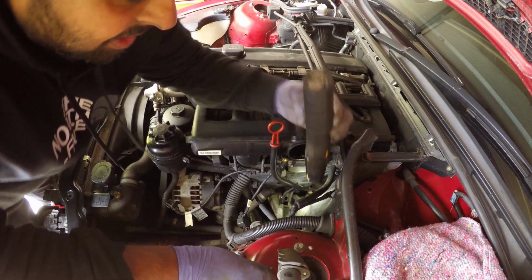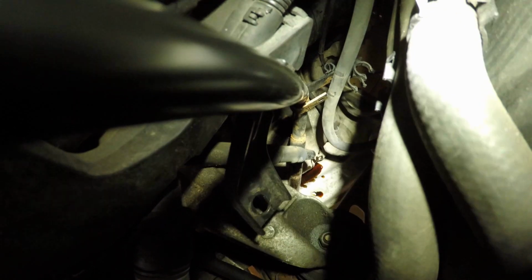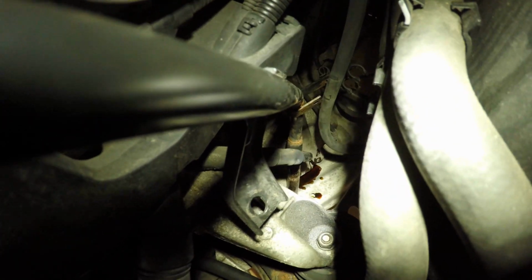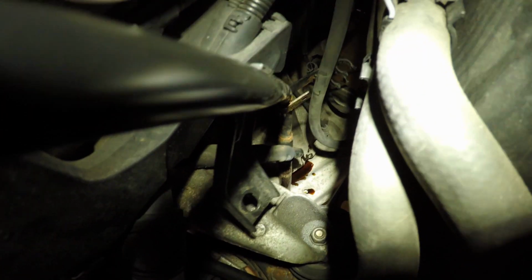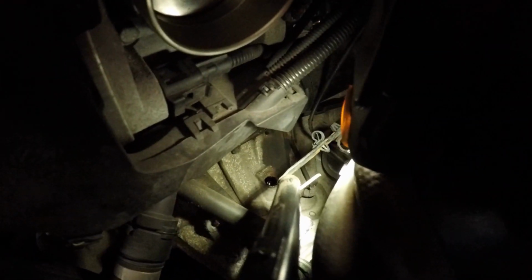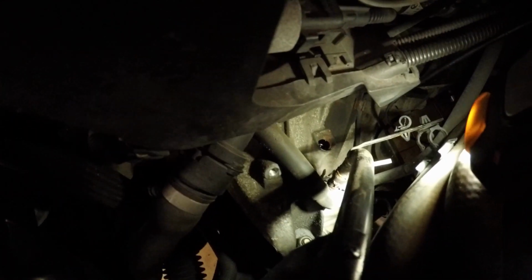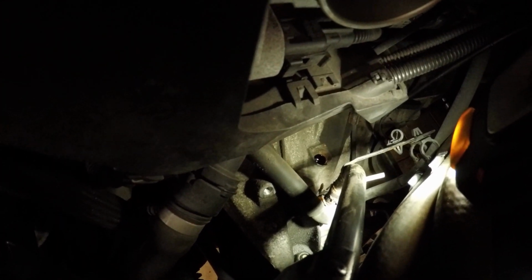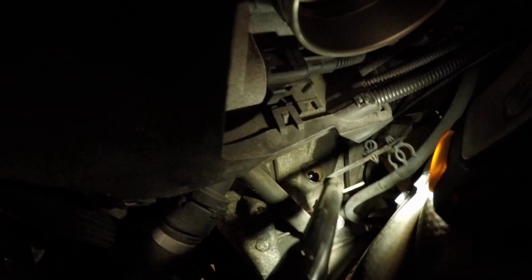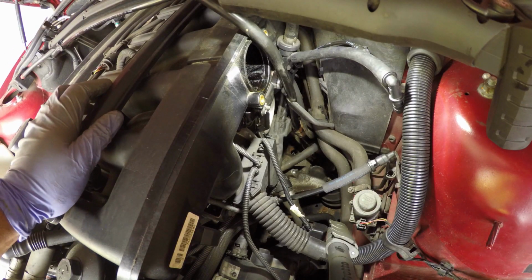And I'm now dripping oil. Whatever oil was in the dipstick leaked out, but not too much. So at least we can clean that. The dipstick tube is now freely moving. The bracket is free. What's happening now is that pipe, that's the drain from the CCV to the dipstick, is stopping me pulling that. So now the dipstick tube is pulled out of the way.